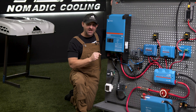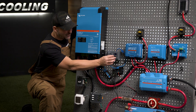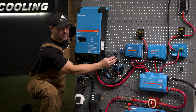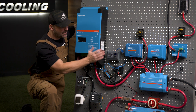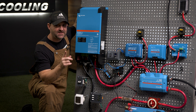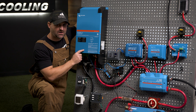If you're charging with an extension cord over a long distance, it tends to heat up. In that case, just dial this thing down so your extension cord will not overheat. And if you're going to an RV park using a traditional 30-amp RV plug, you can dial it back up to charge as fast as you want. It gives you flexibility, and if you're lazy like me, you don't want to pull all your bikes and gear out of the bed just to turn the inverter on and off.